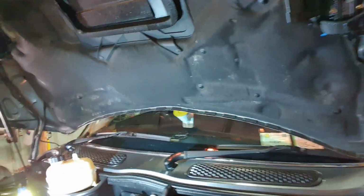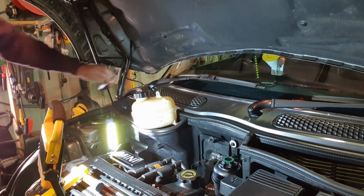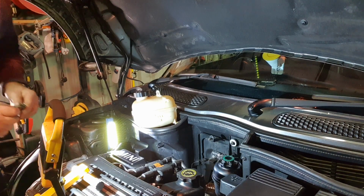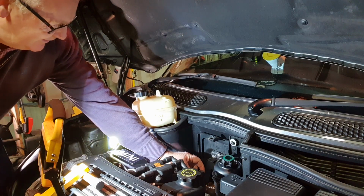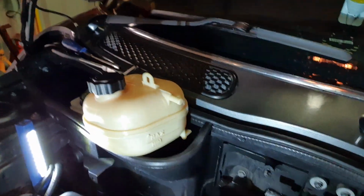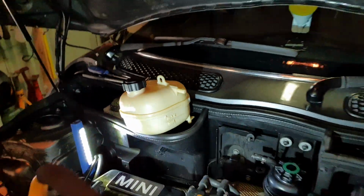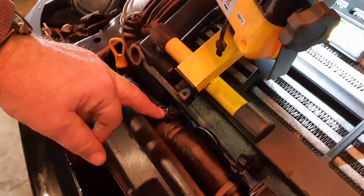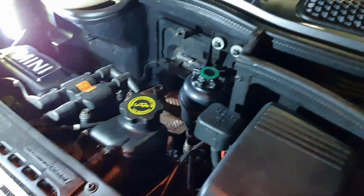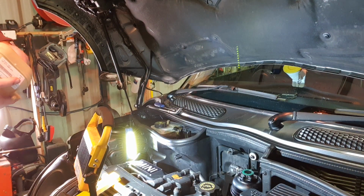So we will commence the application of the new one. Just a great heat out of that thing, just lovely and cozy in here. Okay, so now if you notice, just undo this. See that coolant still on the, right. That's why I'm hoping I won't have to bleed the system. But if I do, it's this guy here, that lad there. There's another one down below the thermostat housing, just down there. But look, I don't think we'll have to bleed the system, you know.